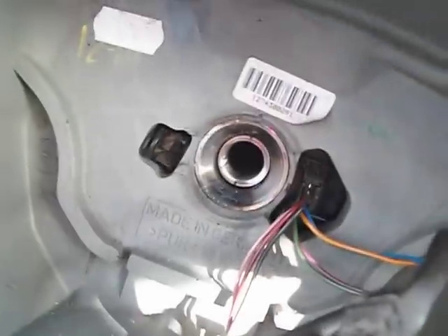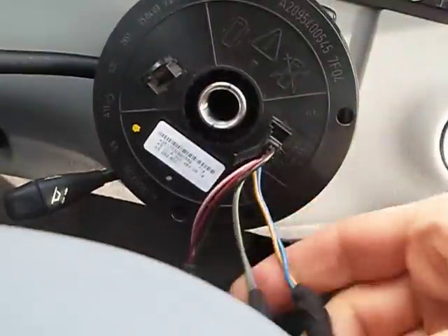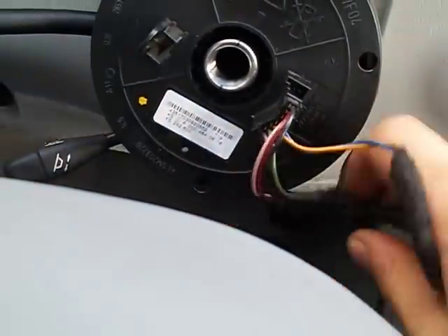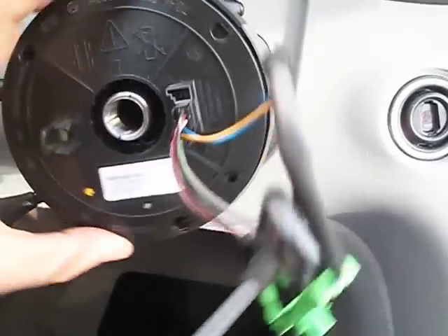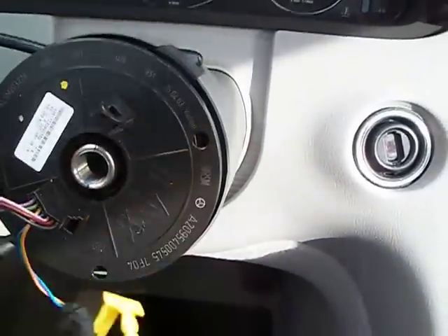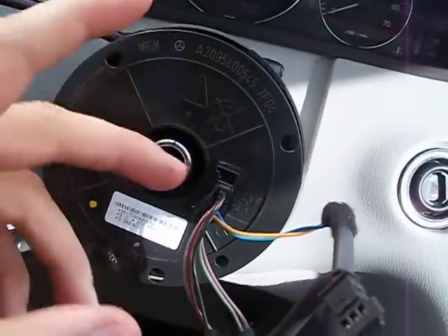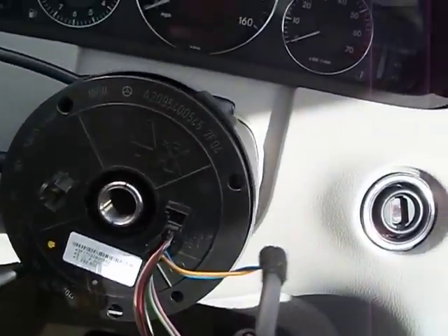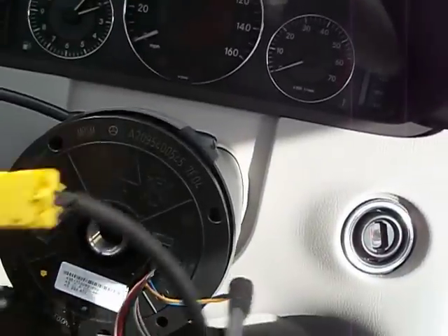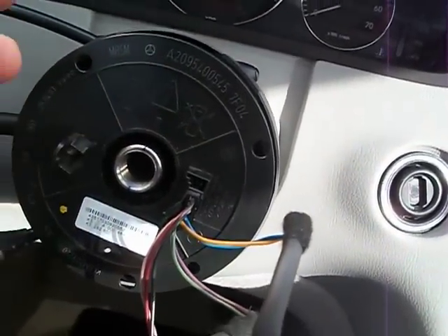The plastic clock spring itself will rotate. Let me show you on the clock spring what I mean. So here is the clock spring — this part will rotate fairly freely. If you go around like this and then put the steering wheel back in, the steering wheel will still go back in here. But this is how the car knows what position your steering wheel is. Now it will think you actually have to turn your steering wheel. So if you do this and put the steering wheel back on, as soon as you start driving the car you're going to get a warning light.